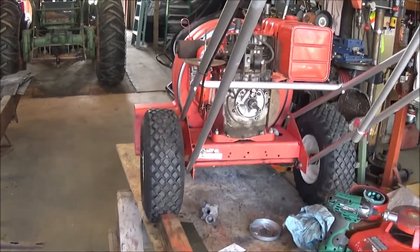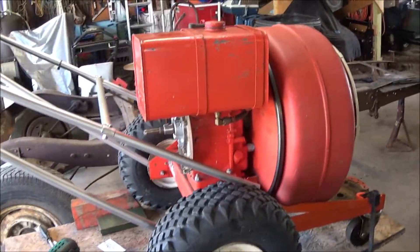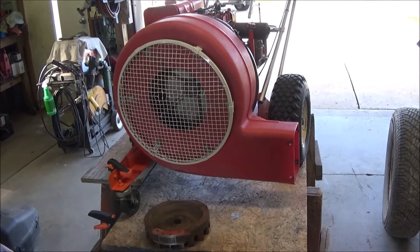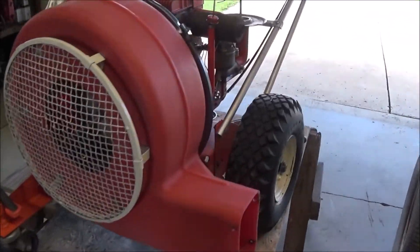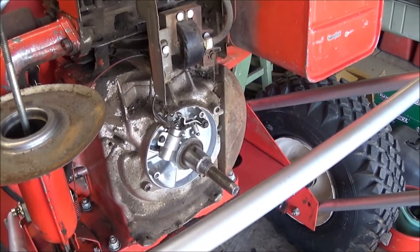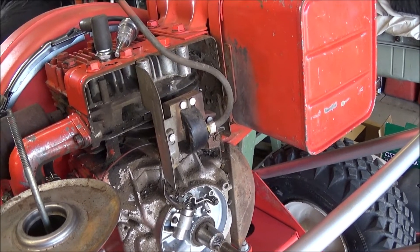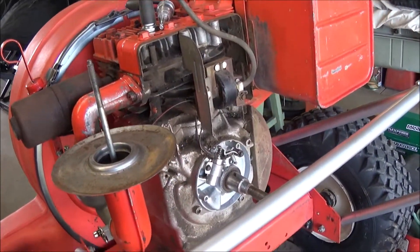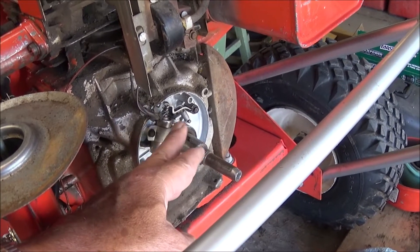I had another little project — I purchased this leaf blower, quite a nice unit. It's pretty old, probably mid-70s, and it's called a Parker. It's got an eight-horse Briggs on it that has an issue with a bad coil. I checked the points and cleaned them. I watched a video showing how to test your coil and it wasn't testing out, so I figured it was the coil. If it's not the coil, I'm going to replace the condenser. Everything looks pretty new down here.